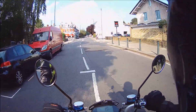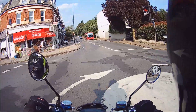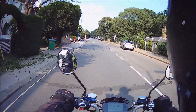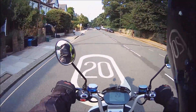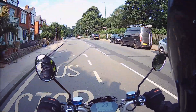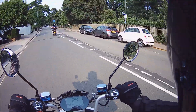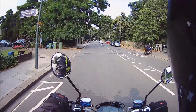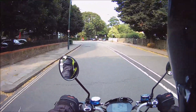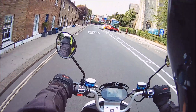The key difference between NIU and this bike is that this is a 60-volt battery. NIU's lower-end bikes, including the MQI GT, are 48-volt. This is a 60-volt, 26 amp-hour battery. Volts give you acceleration capability and amp-hours give you range, although it has to be said this doesn't exactly fly off the mark, especially in eco mode.